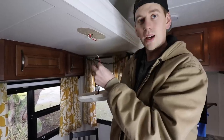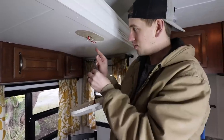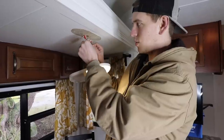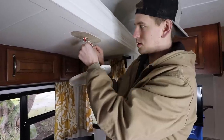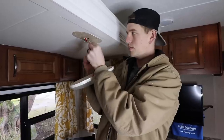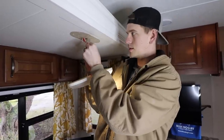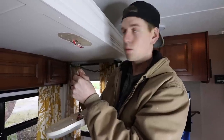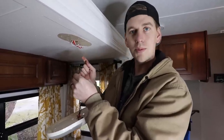One of the easiest ways I recommend testing these is if you have your supply wires together, just touch your other two wires on there and you can make sure that it works. If I originally thought it was going to go one way and it doesn't work, then this tells me this is the right way to do it. Now I'm going to go turn off the power and get these things hooked up to the new light.